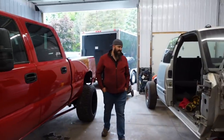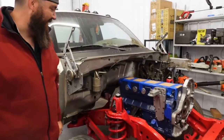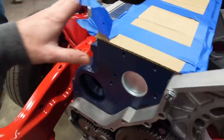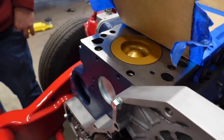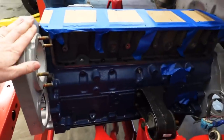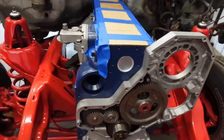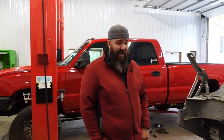Check out this Cummins — I'm pretty impressed. Look in there at some forged pistons. Everything done to this engine is billet and upgraded with the exception of the piston rods, which you don't have to on a Cummins — they can handle 1,100–1,300 horsepower with factory rods. They don't need the upgrades like LBZs and Duramaxes do. On those, you get to 600–750 horsepower and you're on the verge of scattering something on the bottom end, which is what I'm worried about right now. But this thing? No.